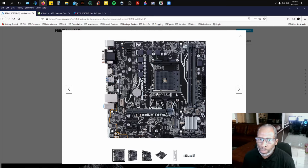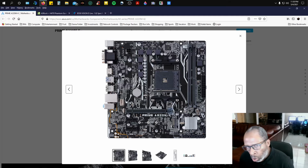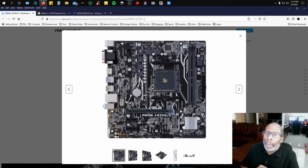Here are your capacitors and your transistors, all right here. Notice no heat sink. CPU power is a 4-pin connect, and a 24-pin connect. When we pick a non-overclocking motherboard, it gives us our basic computing needs. And what I mean by basic, we keep everything in auto setting. We may crank the memory to give us that little extra oomph and speed, but the CPU cannot be overclocked. If you overclock a motherboard like this, you will burn these out.